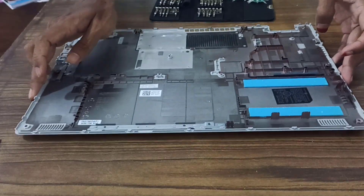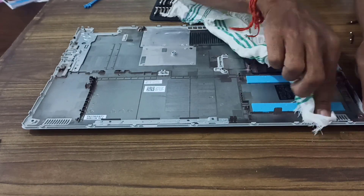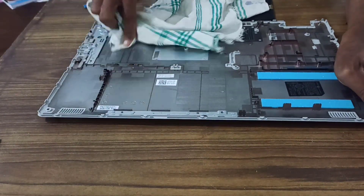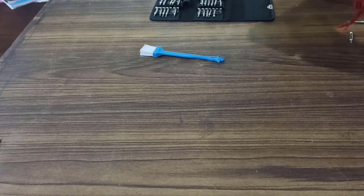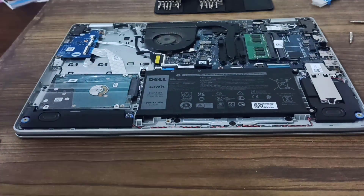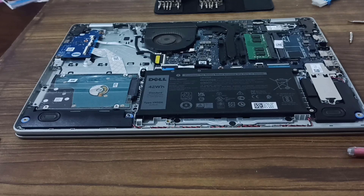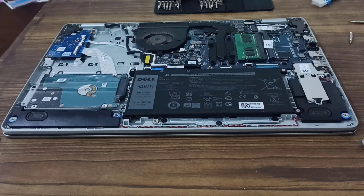All these solutions helped cool it down a little bit, but the result is still not satisfactory. So as my final try and final solution, I am applying this thermal paste. Inside the laptop we have the CPU and GPU chips — very small — and we can apply this thermal paste on them. Let's apply this and hope it works.